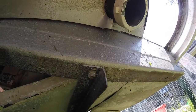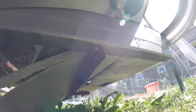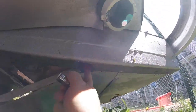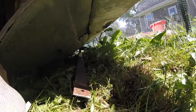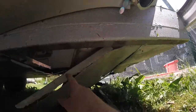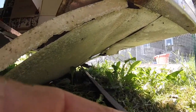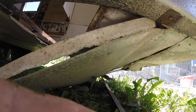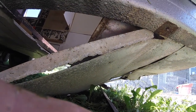I might try and just take that bolt off instead of trying to hack it - I don't have a lot of room. Two turns of the ratchet and it just broke off - broke the nut. Nice and clean break, works for me. I can see the corrosion in the aluminum so I'm just going to pull this all out and leave a partial amount exposed so I can keep tabs on it.